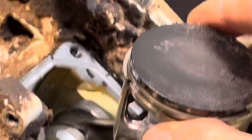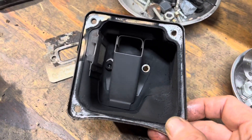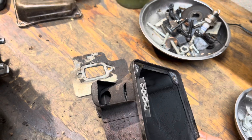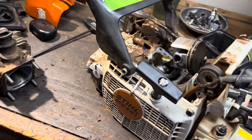You see that traditional coking where the Ultra just doesn't have the detergent package to keep this burning squeaky clean. There's the muffler - screen's good. This thing gets run hard, you can tell by the condition of it.